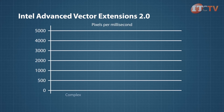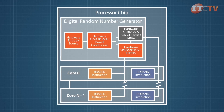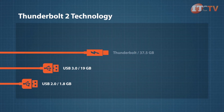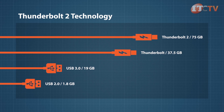In addition to the Intel C612 chipset supporting E5-2600 processors and DDR4 memory, several new technologies have been incorporated into the system to enhance performance. Intel's Advanced Vector Extensions 2.0 improves performance with math, codec, and digital signal processing software, and can also improve facial recognition, professional imaging, and high-performance computing with increased vectorization. Intel's Data Protection Technology with AES-NI provides fast and secure data encryption and is broadly accepted as the industry standard. Thunderbolt 2 technology — already a standard feature on Mac computers — supports simultaneous 4K video file transfer and display over a single cable, with data transfer rates nearly four times the speed of a USB 3.0 connection.